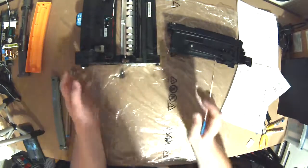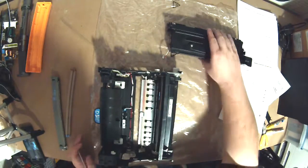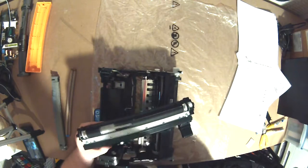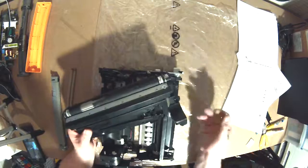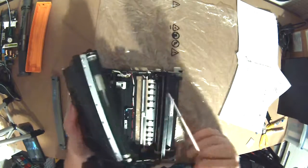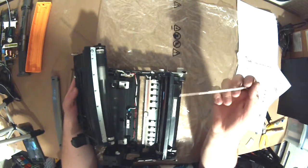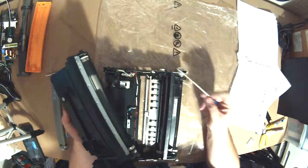But continuing on, basically if you see a print defect, check your drum on these units if you can separate it. Check your developer. As you see here, we weren't getting a feed, so this was ending up being an unprinted stripe down every page. If you get something like this on a cartridge, especially on cheaper printers like your 4000 series, your older stuff, your little 1000s, your little office printers that use a small cartridge, the trick is to take the cartridge back and forth a couple times, run 10 or 15 sheets, and see if it corrects itself.